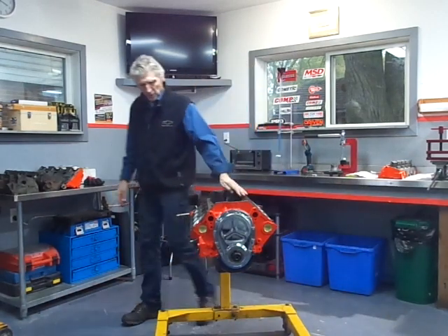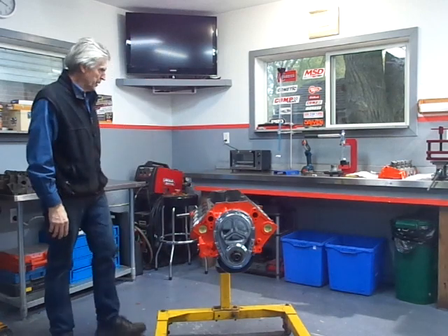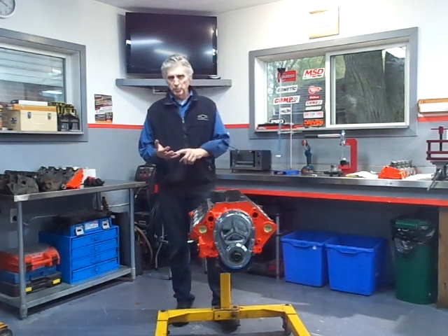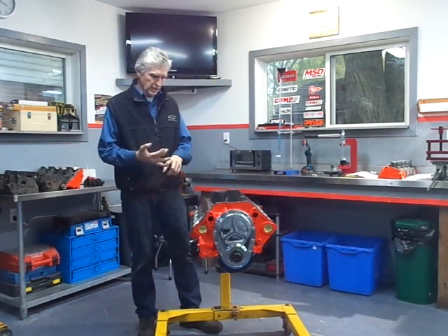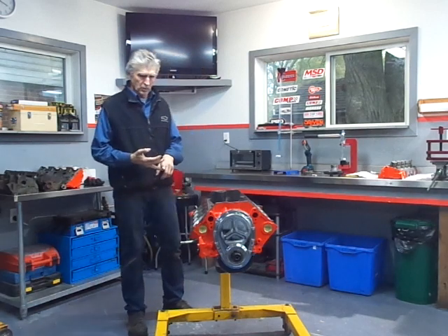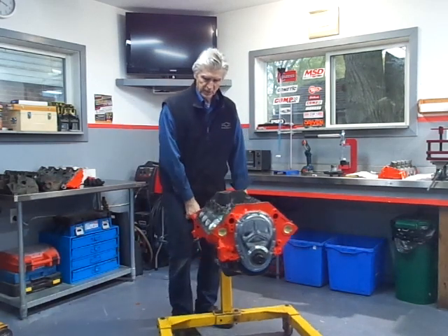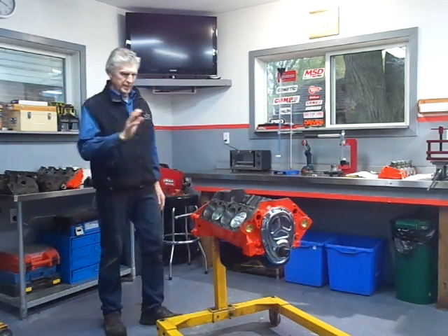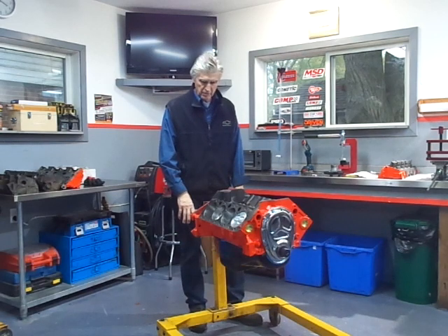Hey, welcome to Gold's Garage. This is part 3 on my 307 project build and we're kind of out of a stall right now, so I thought I'd provide an update and start filling in some blanks of things I previously mentioned. There's been two previous videos on this 307 — one when it was hanging on the hook all grungy right out of the 1969 Chevy truck, and the second a few days ago when I had all the parts prepared, cleaned, and ready for assembly. As you can see, the short block's together, pistons are all in, camshaft has been degreed, short block assembly is done, the pan's back on — so we're ready for accessories and cylinder heads.